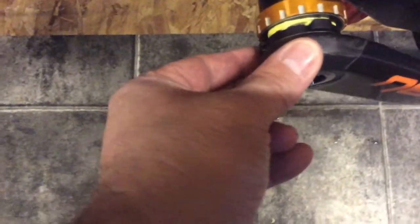All you need to do is put an 8mm allen key in this hole and tighten it up to about 50Nm. Then turn this preload adjuster and nip it up. There's a little bolt at the top — just do that up so the gap is taken up, and that should be your cranks adjusted.